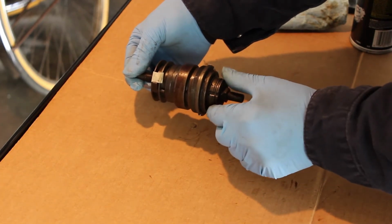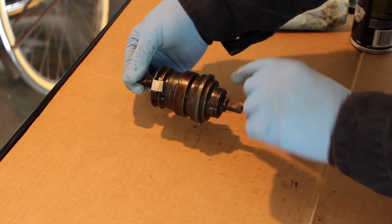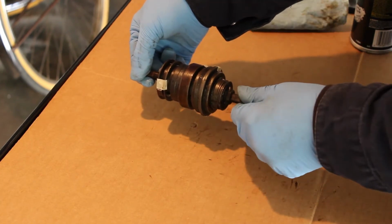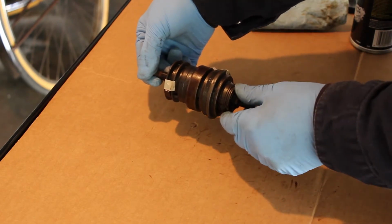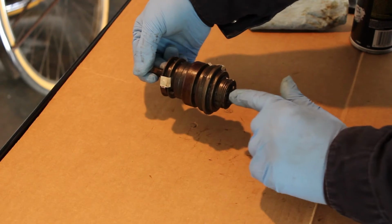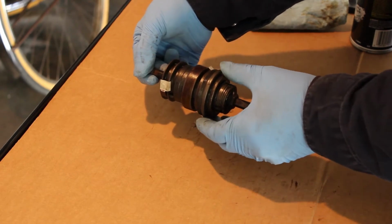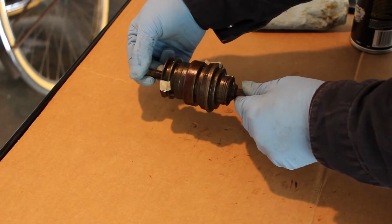to here. And what you can see, what has happened is, I've made one turn, but the wheel has made about 25% further, or a quarter turn further in that one turn. This is how third gear actually drives the wheel faster than your one turn. So third gear, the drive goes directly into the cage, and the output is into the ring gear. We'll go deeper into this once we take it apart.